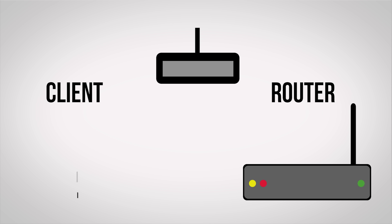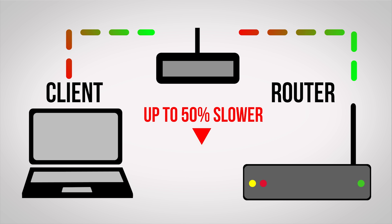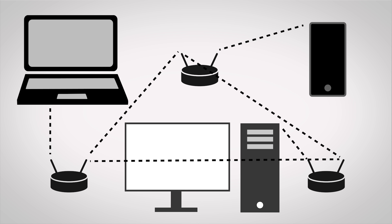Hold on — a cheap range extender for your wireless network sounds like it does the same thing, so what's the difference? Garden variety Wi-Fi extenders or repeaters are notorious for degrading network speed, because their antennas have to communicate with both client devices like your phone and laptop as well as your main router. Your effective speed can be reduced as much as 50% while using one. By contrast, nodes in a mesh network are typically engineered with separate antennas so they can talk not just with the main router, but to each other.